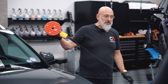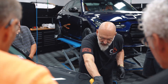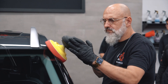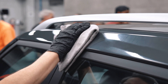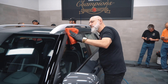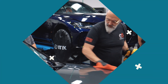From there, we deposit the pad on the surface and then it's as simple as applying it. No pressure on the machine, just gliding it across the surface. I don't add anything until I see it's not leaving anything on the paint — if there's still a little snail trail behind me, I'm good. To wipe it off, use a dry medium nap towel, and we're ready to apply the coating.